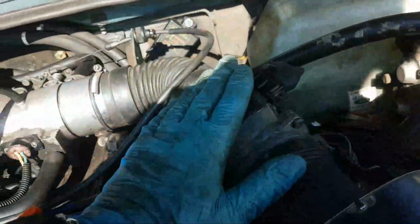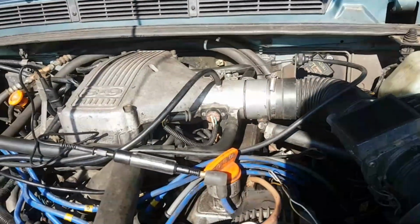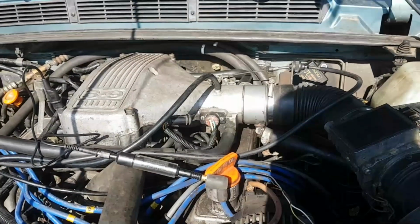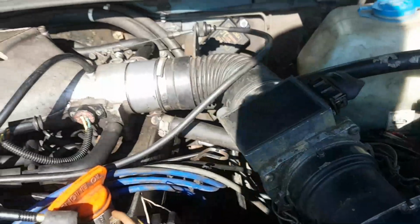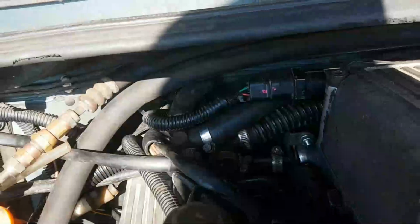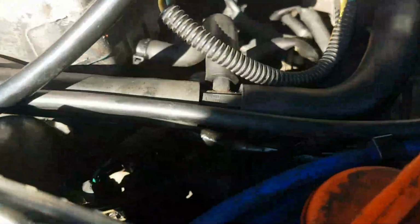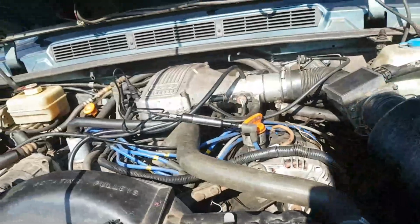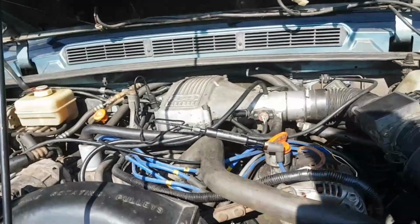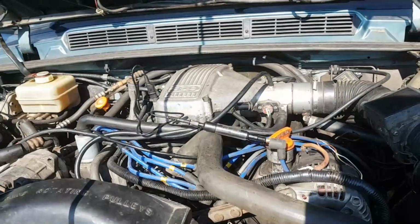So if either these or various other components around the engine fail, you can just disconnect them and they go into a fail safe mode. The engine will run without the throttle position sensor. It will run without the airflow meter and without the air bypass valve at the back there with the 2 red dots on it. It will run without the fuel temp sensor or the water temp sensor, because it goes into a fail-safe mode. It's a very, very simple system. Just perplexing me, that's all.